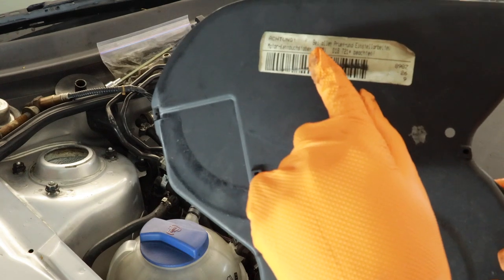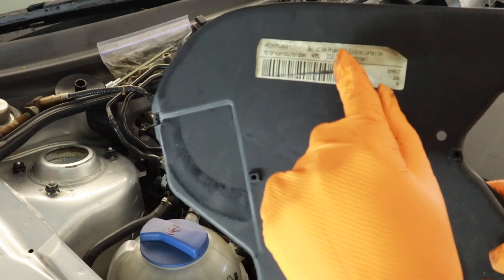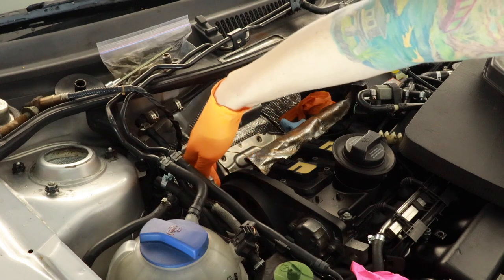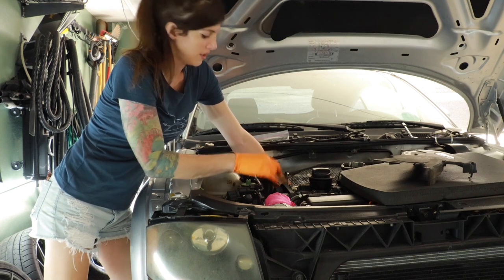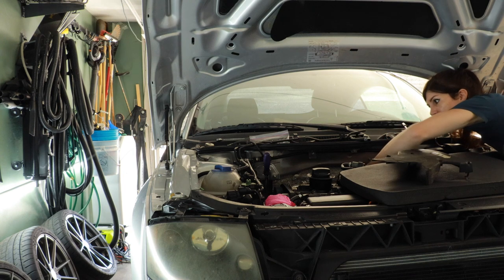Hello — that was yummy. Back to work. Behind this cam gear off to the side is an allen bolt that holds this shield in place — it's a huge pain to get to. I can't tell if the nut is turning... I don't think it is. There's no way this is going this easy. This is going this easy. There's another bolt that goes in here somewhere.